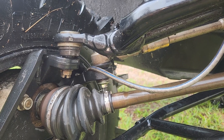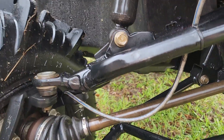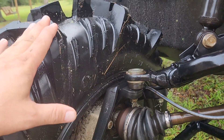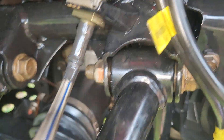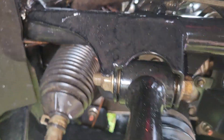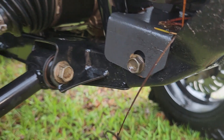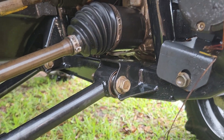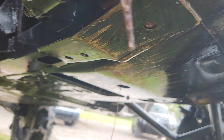If I have any more issues I'll certainly let you guys know. Everything else on the front end seems tight after a few hard rides — really put it in a bind yesterday and beat on it. This tire was totally buried in a hole with some ruts and nothing tweaked. You can tell nothing tweaked if you look at the gap between your arms; when it all looks good and symmetrical, that's a pretty good sign. Look for paint chipping off near your welds and your tabs too. I'm not running frame stiffeners — I just torque the heck out of these four bolts and nuts and this thing's been really solid. Honda did a good job on this beef-up, having double shear tabs on both sides.